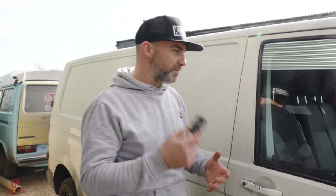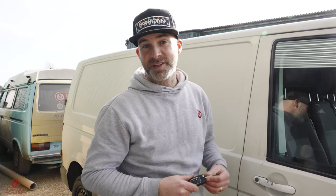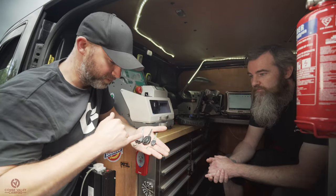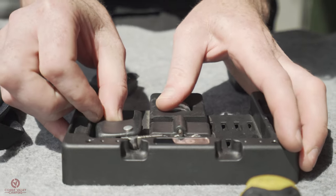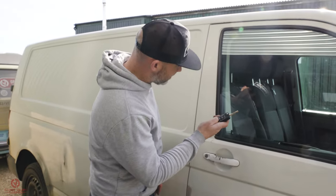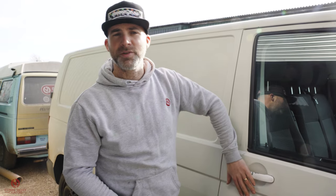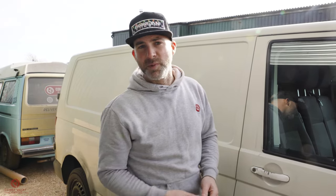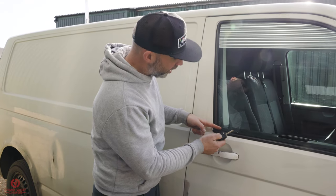The keys for this vehicle were definitely 200,000 miles old — they were knackered. Luckily I had both of them. We now have two brand new keys thanks to Richard from Brighton Car Keys. Once we got the new key and battery working, we found that this door doesn't open or close with central locking. After research, it turns out the door locking solenoid mechanism within the door has gone. That's why we've bought the genuine VW secondhand part, and today we're going to get that pin opening and closing with the central locking button.